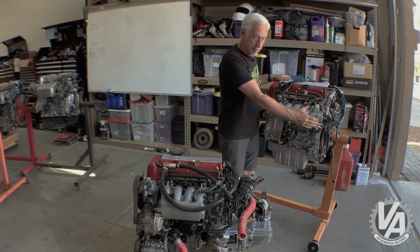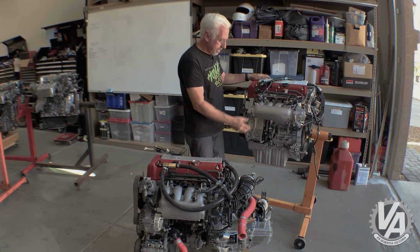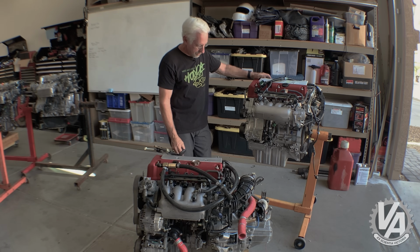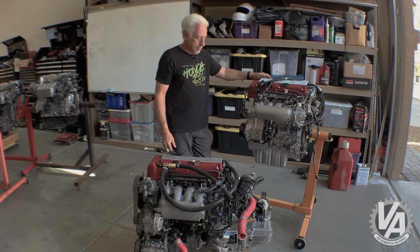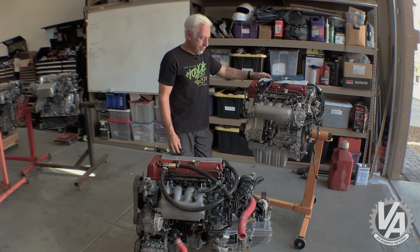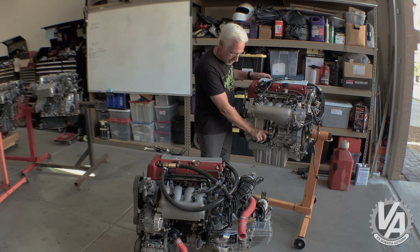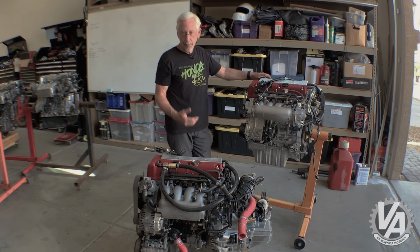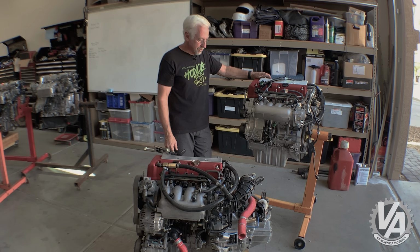This particular one is drive-by-wire because it comes in the 06 Civic, which is drive-by-wire. And there is also down here, you can look at this manifold here for the radiator outlet, and you'll notice that it points up just like it does on the US Accord and US TSX. If you want to use that for a swap, you're going to want one that points down rather than up, because that works with most of the swap radiators that you find here in the US.